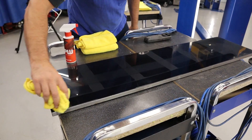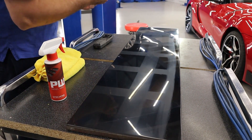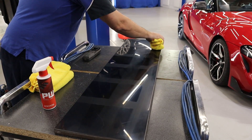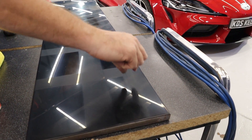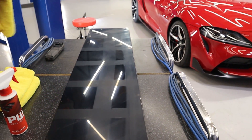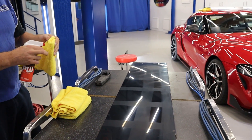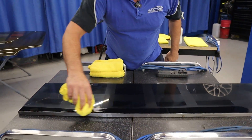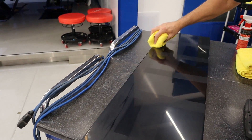I'm going to use G-Technics panel wipe and run through this last strip. You can see it's going to flash much faster — it's a more volatile product. Let's wipe any residue off. There's a darker patch and a dull patch — that's the oils and fillers being lifted and spread around. Any panel wiping you do, especially before a paint shop, you should always panel wipe twice. You panel wipe, then quickly wipe with a second cloth to remove the residue. I'm going to use it again to remove all of that final residue — you're lifting it off the surface, then you're spreading it back around. Turn the cloth quickly and wipe it dry.